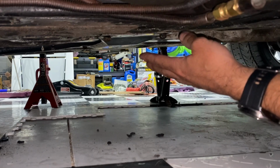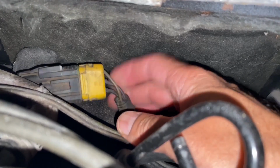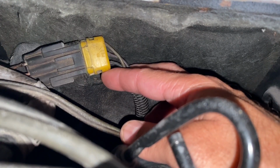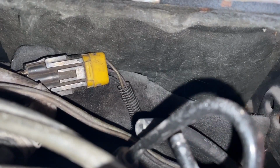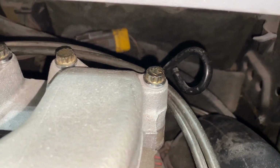If not, I was going to try to modify it. But the straps are up. The gas tank is up. If you come behind the engine here, you can connect the harness for the fuel pump. And just reach around near the firewall, make that connection, plug everything securely, and you can see here where it's located right here behind the engine.